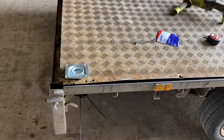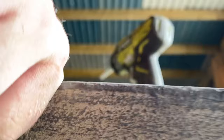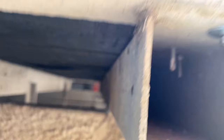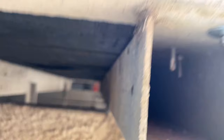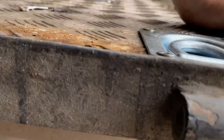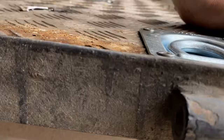That's five deck rings in — we're halfway. Like I said, we're putting them every four feet. Luckily we've got them all into a rail. There's only one bolt on the wood, it's reinforced with the aluminium above. The back bolts are on the side of the chassis and the other ones in it. So we've got one bolt in the wood, two in the back rail, and one down the middle of the chassis. Same on the corner — we've got three good bolts. These bolts are expensive for these deck rings.